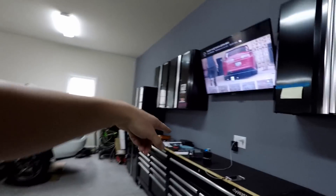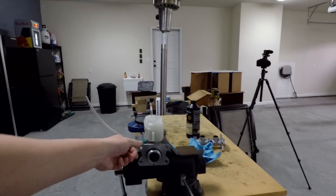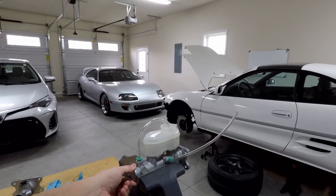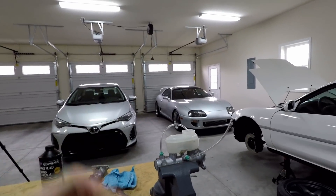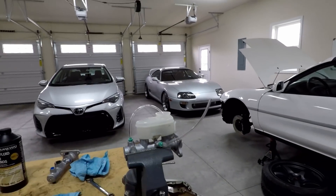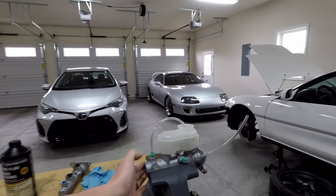All right guys, back in the garage as usual, drinking a Coke — Keystone. Right now we are about to bench bleed my master cylinder. This is off a '96 Land Cruiser, which has a slightly bigger bore. Most people use a 4Runner, but unfortunately my local AutoZone and Advanced Auto did not carry the 4Runner style. This is off a V8 Land Cruiser from 1996 — uses the same exact bolt pattern, same exact layout. This has a one-inch bore versus I think a three-quarter inch bore, so this will give me better brake feel over what the stock master cylinder gave me.